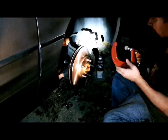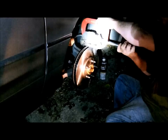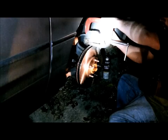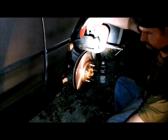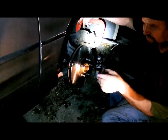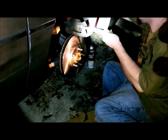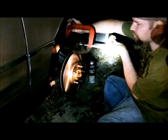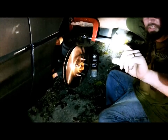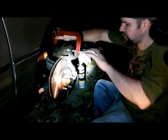Use a big six-inch C-clamp like this. Line it up on there and give it a little turn — just a little snug so it floats above. You can actually get a tool that's meant for this, but the old pad works just fine. The pad that has the little tab — the screecher — you want to put that on the back side against the piston. Before you push this in, make sure you open your brake reservoir cap so the pressure doesn't push fluid out. Also make sure you've drained down the reservoir a little bit so that when it rises, it doesn't overflow and dump brake fluid everywhere.